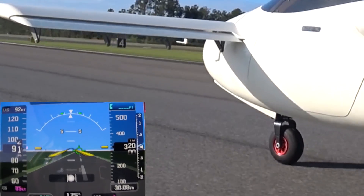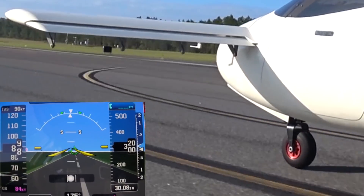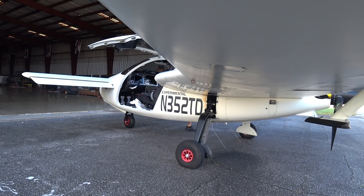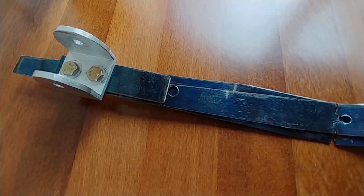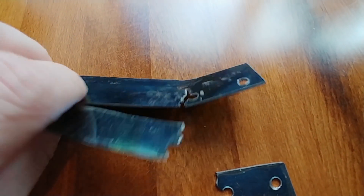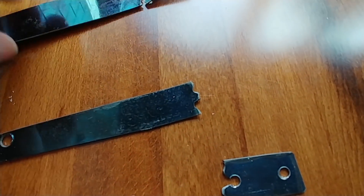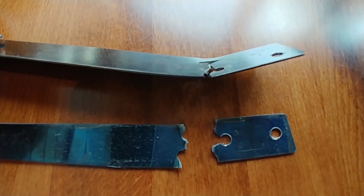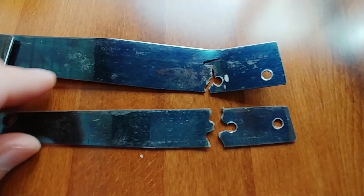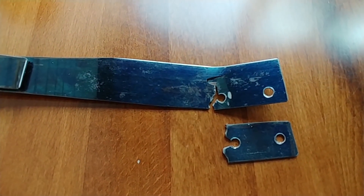Basically what it means is I need a little bit more trim than I had in, because I was having to pull back pressure myself. After parking the aircraft, I looked at where the elevator trim was set and it was almost at the very stop — I really needed a little bit more range. So I moved the mounting position using another hole I already had. When I did a stress test pushing it all the way to the other end, I ended up breaking the spring. It was cranked at such an angle, and there wasn't anything stopping it from bending right where the AN3 bolt was going through with a washer. Those holes I drilled with a drill, which turns out isn't ideal.